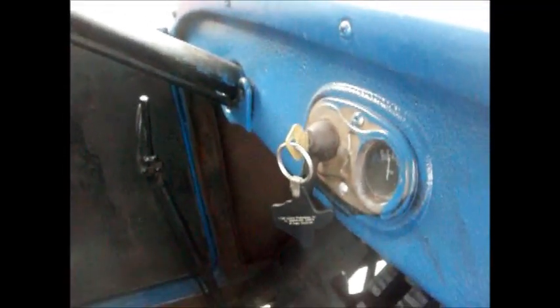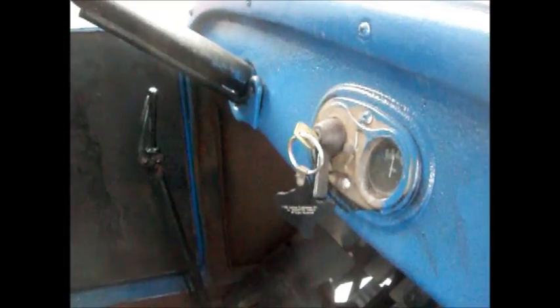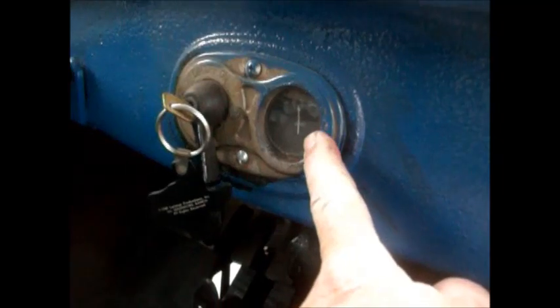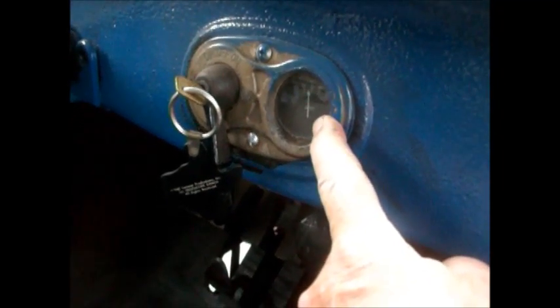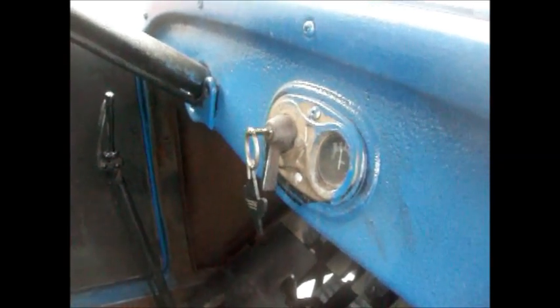I have a few videos on YouTube of how to start and drive the car. Make sure that your parking brake — this is in neutral — goes all the way back in park. And when you start the car, the rear wheels should rotate either not at all or very slowly; the parking brake should be engaged. When you start the car, you can check the ignition and the magneto. To start the car on the battery, it should start right up. After you start on battery, check your ammeter to make sure you have a positive charge. You may have to increase your engine RPM because of the generator. Then switch the key to magneto — the car should actually run a little bit better since you are producing higher voltage than the battery.